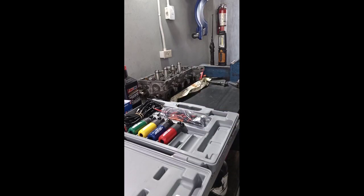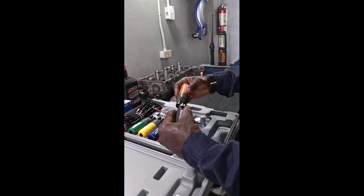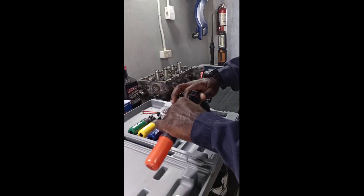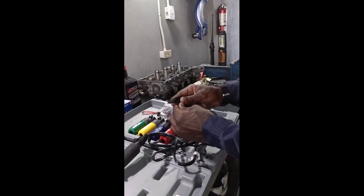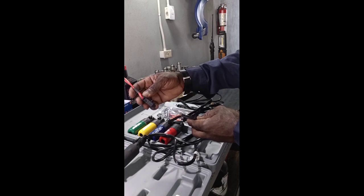With the master kit they include the buzzer. So for instance if I'm checking out lights in the back of the car, I've got this hooked up to the fuse box — when it trips, it makes a loud buzzing sound to let me know the fuse has popped. You pop this on like this, attach the next side to it, and it comes with a long cable so it can reach the back of a normal car.